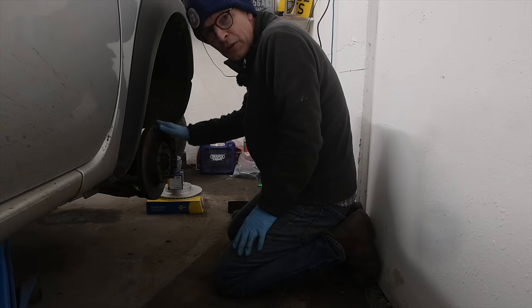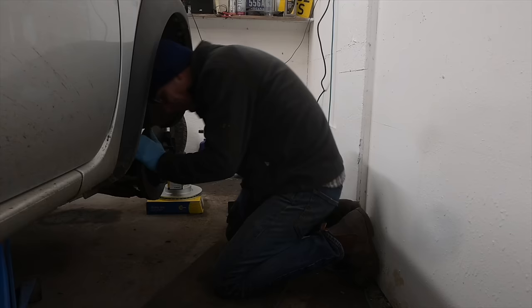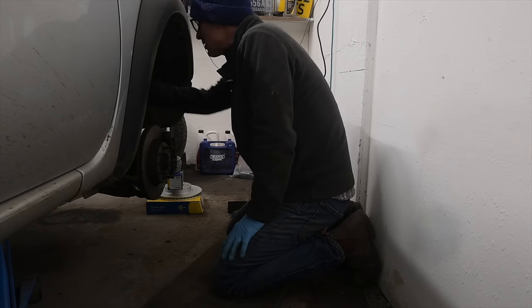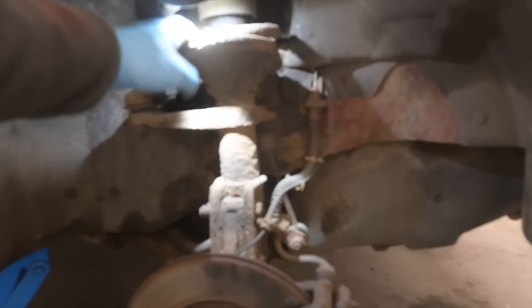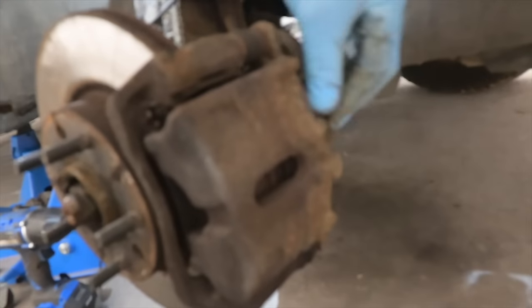Let's have a look at this and get some Bulldog on all the fittings because I've never taken this apart before. There's a bit of a lip on the disc — not too bad — and the pads are about halfway worn, but I want to make sure everything is tip-top. So I'm going to give a good inspection to all the rubber hoses and all the solid lines. It passed an MOT recently but I want to be doubly sure. This front strut was an advisory last year for a slight weeping of fluid, which I guess means it's lost all its fluid now. The flexi lines look alright — I do not want to ever try and undo them because they look like they're going to fight to the death.